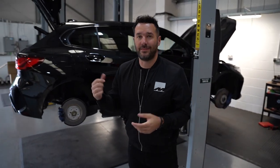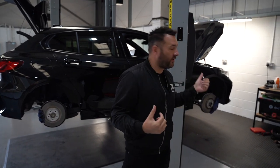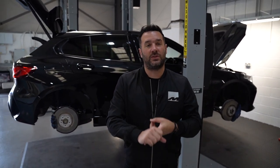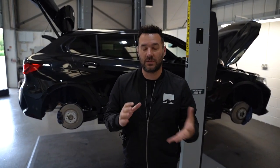The first one's already on the ramp. This is a black car with a black M Performance body kit, to go with our black wheels — it's going to look amazing. As you can see, wheels are already off and Nick's already on the front end of the suspension. He's going to have the 30mm drop on the front and 25mm rear with our wheels. It'll be absolutely perfect. The second car has just arrived and that's a blue one, so we'll see what that looks like.